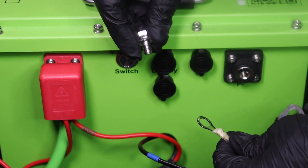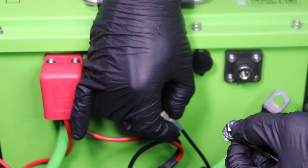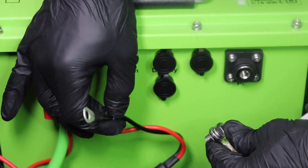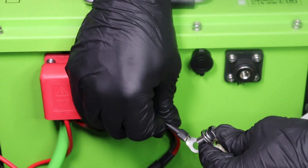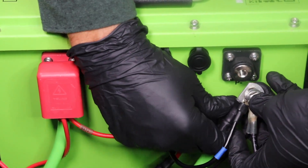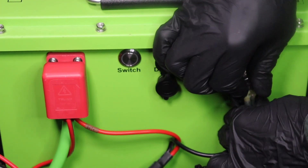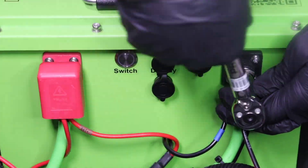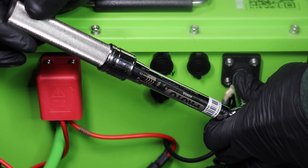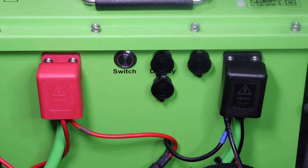On the negative side, the smallest item is the ground from the 12-volt fuse block. Next is the black wire from the 12-volt reducer, followed by the black wire from the charger output pigtail, and the final item is the new Bolt Energy main negative cable. Use the provided hardware to secure the wires to the negative terminal and tighten using a 13 millimeter socket and torque wrench to 11 foot-pounds or 132 inch-pounds. Finalize by sliding the negative terminal protector in place.